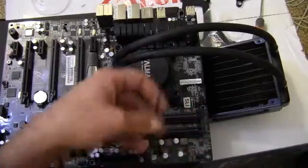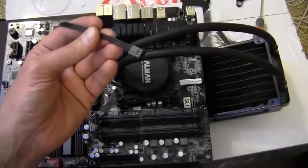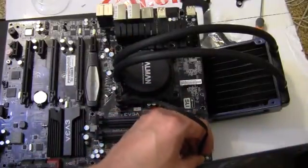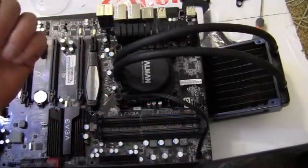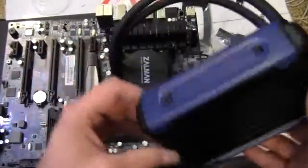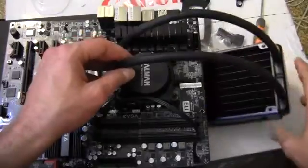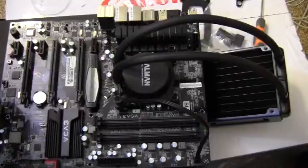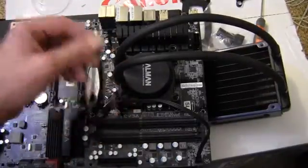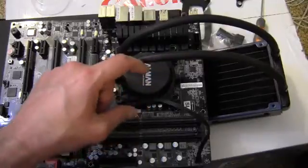You just don't know what voltage the board's putting out on a fan header, and you don't know if the pump even works. I'd definitely recommend connecting it directly to the power supply for at least the first boot, until you can get into your BIOS and confirm all your fan headers are getting 12 volts. After that, by all means plug it into a motherboard header. Now all I have left is to install a fan and mount the radiator. It's going on a test bench, so I'll have to get a little creative, but I want to do some temperature testing.